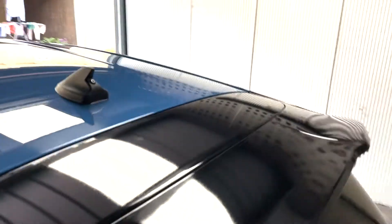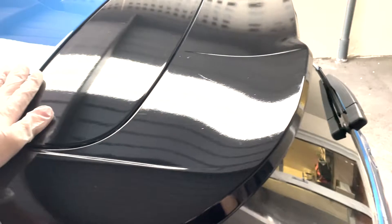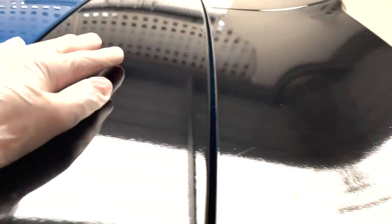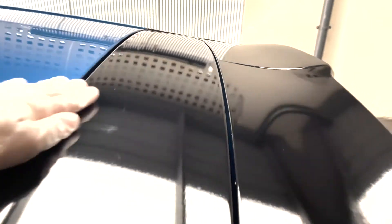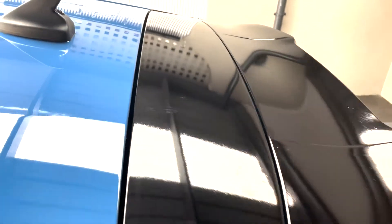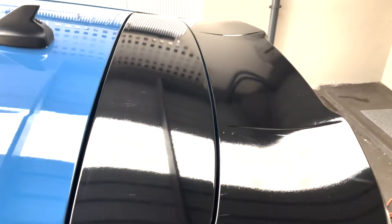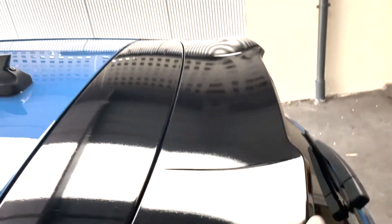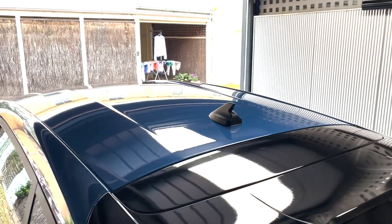Last night I was feeling a bit impatient so I had a crack at the rear wing panel — it came up pretty good. I will say I didn't cut far enough out on the gaps, so on the inside it doesn't quite come down as much as it should. That's definitely something to watch out for if you're trying this yourself. Apart from that I'm pretty happy — can't see any bubbles. Now it's on to the real challenge of the roof.